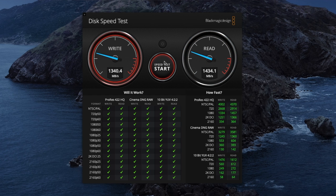I've gone from 256 gigabytes to 512 gigabytes, and the whole process took me less than half an hour, including cloning my disk. It was really easy to do and I'm very happy with the result. Now I've got the additional capacity, but what's the performance like? Running a Blackmagic disk speed test — a 5 gigabyte stress test run three times taking the average — we're getting just over 1,300 megabytes per second on write performance and just over 1,400 megabytes per second on read performance. That's almost double the SSD we replaced. So we've got our capacity increase, we've got a performance increase, and we've still got our original Apple functionality. Upgrading with the Generation 4 genuine Apple SSD was a great solution.